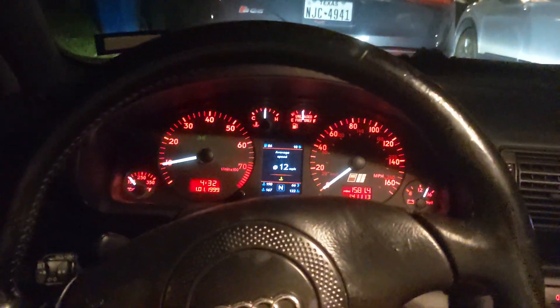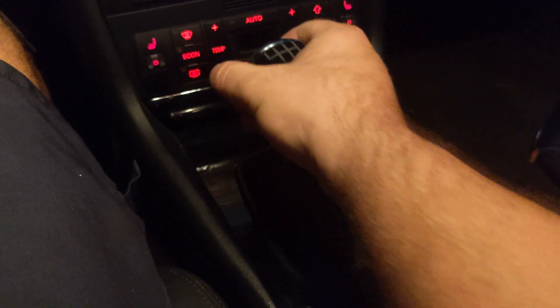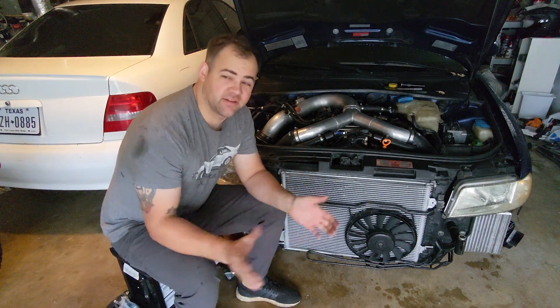I'm going to explain what's going on with my clutch. It seems that while it is grabbing okay while driving, if I depress the clutch pedal all the way, it will either lock me in or out of gear and the car will actually start to creep forward while in gear. My first thought was to bleed the clutch. I'll also get into a discussion with Mike Hood about what could be going on with the pressure plate and the TTV flywheel setup.